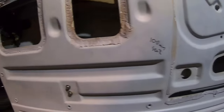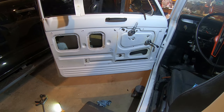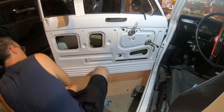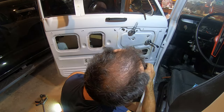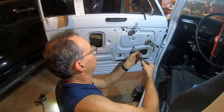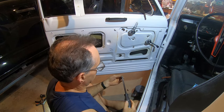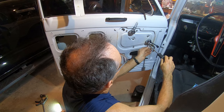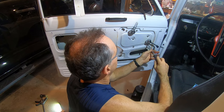Once you tint your windows like I did. Of course there are more bolts — two more nice, clean, perfect bolts. They're not stripped out from people that don't know how to use the right Phillips. You've got to use a number three. Don't use a number two on a number three hole or vice versa — you're ruining it for the next guy. Too stupid to use the right Phillips. I just put my hand in the grease again.